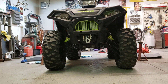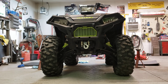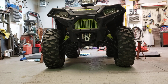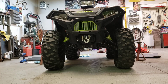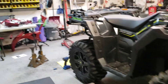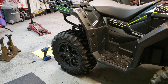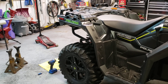It's a two-inch bracket lift. We measured my bike when we put it in, and after the lift was installed, we rode it around the block a couple times and parked it — I gained about just under two inches, probably an inch and seven-eighths or just a hair over that, so it worked pretty well. I turned the front shocks all the way off and then just one click back up. The back shocks are just two clicks up, just because we've usually got a little more cargo on the back. Once you get that back on there, riding more towards the back, the back springs being turned up a little more than the front seems to level it out once you get everything loaded back on.